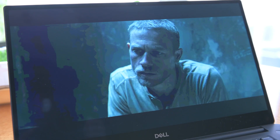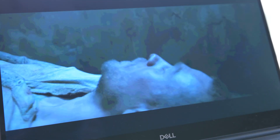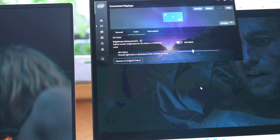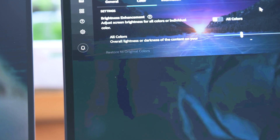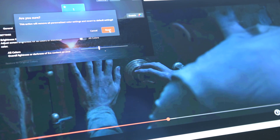The OLED display is better overall in terms of image quality but it does have its issues. It's a little bit thicker and heavier than the LCD panel, and what is a bigger deal is the black banding that occurs in a lot of movies — in darker scenes the blacks seem to turn into pixelated blocks. I did some research and figured out it's because of the Dell color monitor software. If I go into the Intel display driver I can reset the color calibrations and the black banding is gone, but anytime I adjust the brightness it comes back instantly and I'd have to go back and reset the color calibration. It seems to be the Intel display driver and Dell color calibration software messing with each other, and I haven't fully figured out a fix yet.